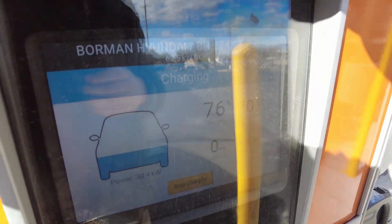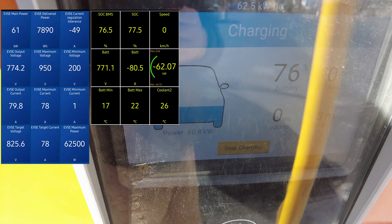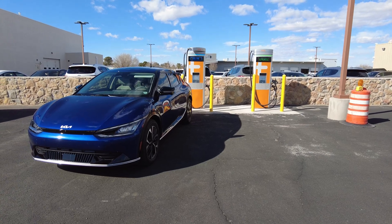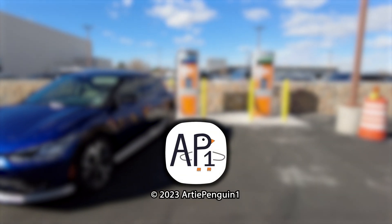You can see we're plugged in right there, going past the 37 kilowatt limit we hit last time with the cold battery. Right there we're pulling 62 kilowatts, battery minimum temperature 17 Celsius — we're getting this station's full power output. So that's going to be pretty much it for this cold weather charging test video. Thanks for watching everyone, be sure to get subscribed and check out other videos on my channel.